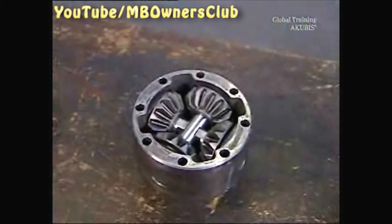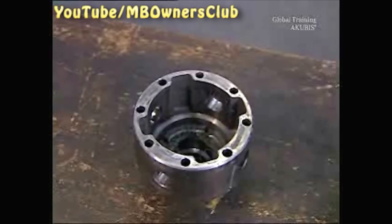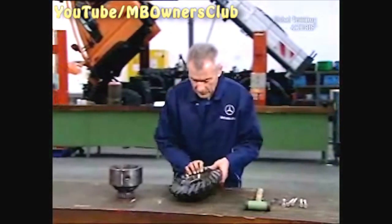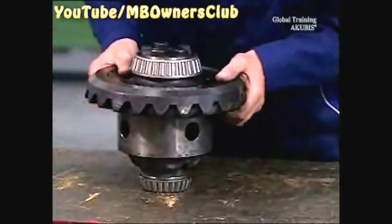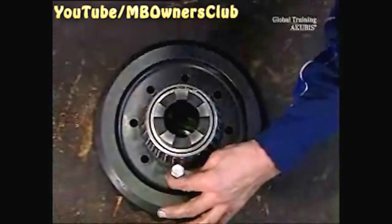Drilling chips fall into the casing, so be sure to remove all the bevel gears. Put the differential back on without the bevel gears and shafts. Pay attention to the correct installation position. Put four screws in the housing, moving outward from the dowel screw. Leave three screws out — this is where the new dowel screws will be. Tighten the nut hand tight, and then go over to the drill.